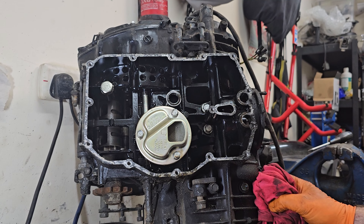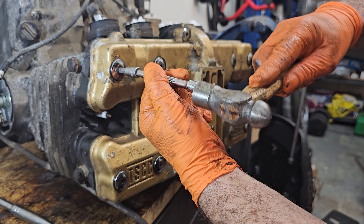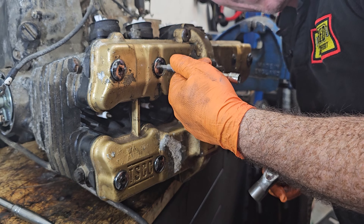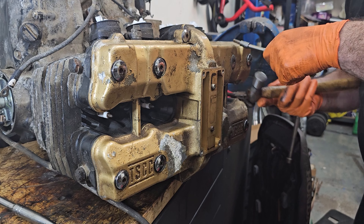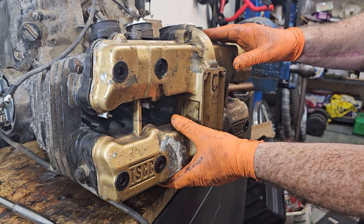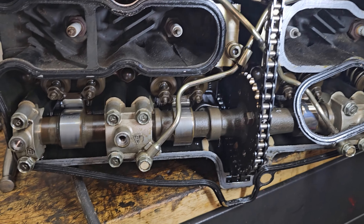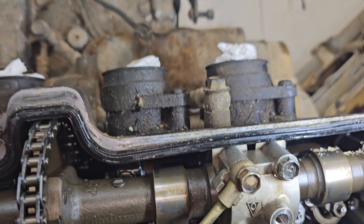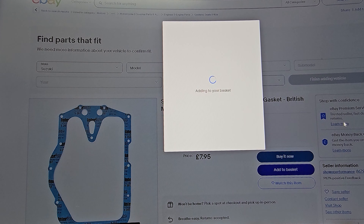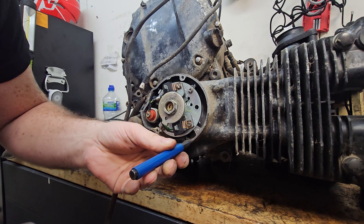Now let's swish this thing around and work on the top end. I'm just going to go around with the allen key first and make sure all these will seat properly. I know some of you will be saying don't hit your toes with your hammer — I don't care. I've had a lot of Suzukis in the past and I happen to know that the bolts are notoriously like cheese. Just look how clean that is — absolutely pristine in there. That does not look like an engine that's done 42,000 miles. It's just a very, very well serviced one. There's no play in the chain.